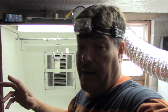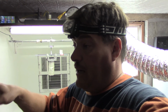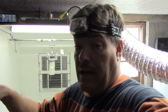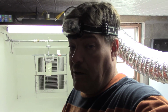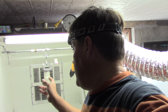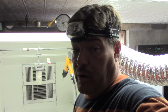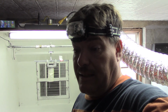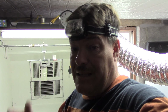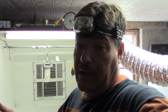I'm not going to pre-bake them. They're just small parts. Actually, the headliner glues to those little headliner pieces. You'll never see them, so if I get a little bit of outgassing, it's going to be okay. And hopefully this part will do well too. Like I said, I'm not going to pre-bake it or nothing like that. The reason you pre-bake it is in case there's something in the metal, then once it heats up, it would release, and then it would look like dirt in the coating.